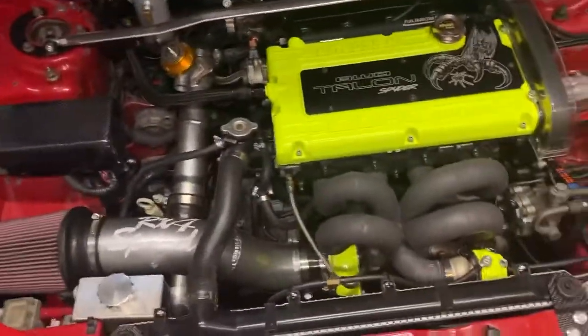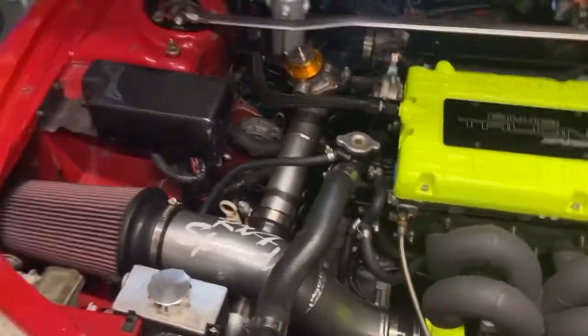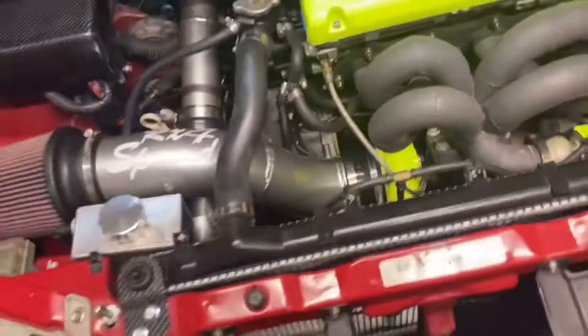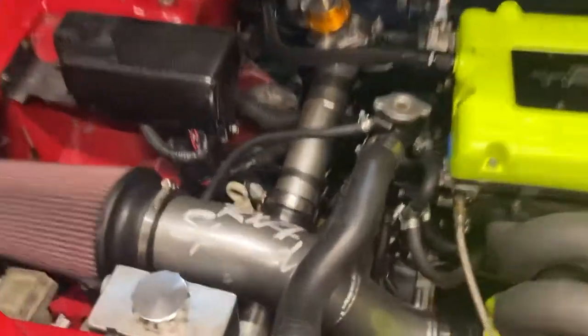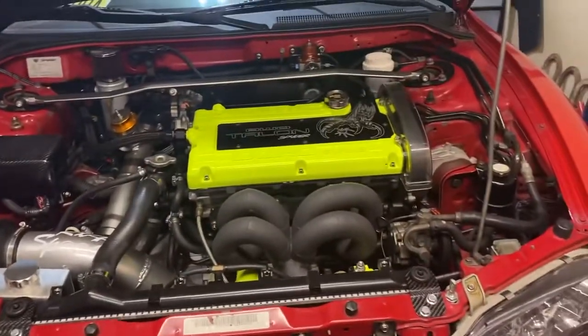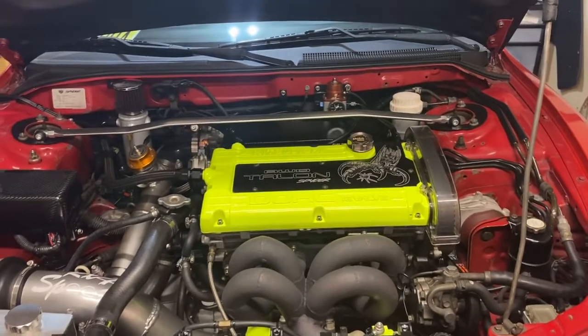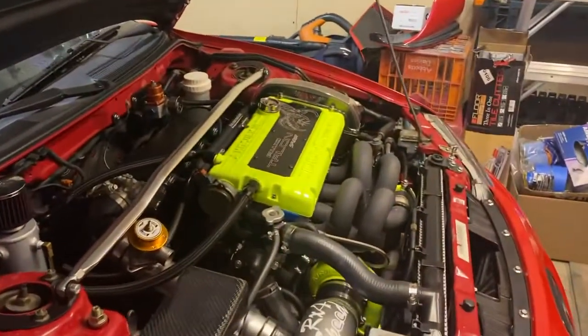Even though she's kind of a garage queen. Simple setup — 3.5 turbo, 2.3 stroker, somewhat built automatic transmission, got all the Kiggly goodness in there, Tial wastegate, NRG Type-S style blow-off valve. Bar's helping out with this whole build basically. This is a fun little street car — E85 flex fuel — 30 psi for now until we get some track time, and then we'll go from there.